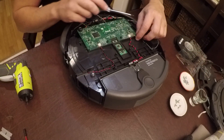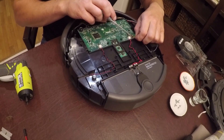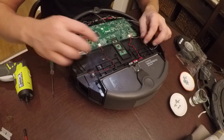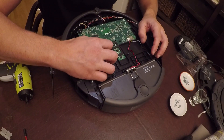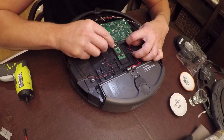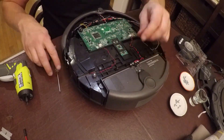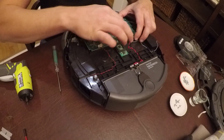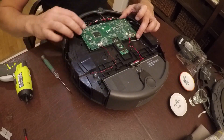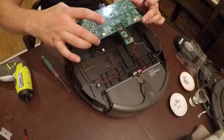Okay, the motherboard screws are all removed. Now we're going to take our WiFi antenna off and just pop that little socket off of there. Easy — get these guys out of here. Give it some wiggling, don't try to force it. It's on these studs — there are four. If you try to peel at it you're going to crack something, just wiggle it, and now it's free.